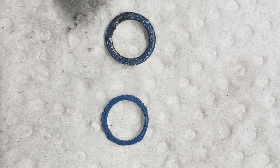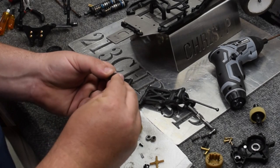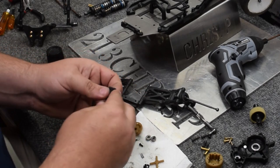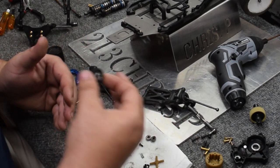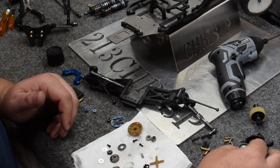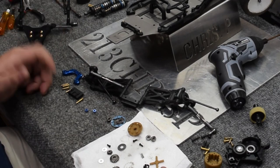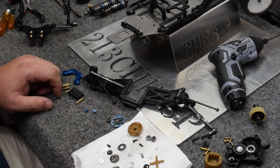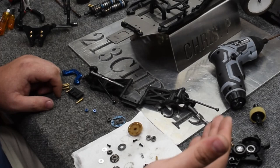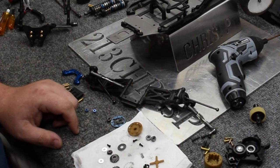When it comes to racing applications, the freer you can get any drivetrain, the better off you're going to be. It's not about horsepower — it's about drag. Drag is the killer to any race car, whether it be off-road, street racing, or road racing. So free up all of your ball bearings. That is hands down going to make lap times quicker. It may be an eighth or a tenth of a second faster per lap, but that's a tenth of a second you're going to gain that somebody else may not because they didn't take the extra steps to prepare their ball bearings.